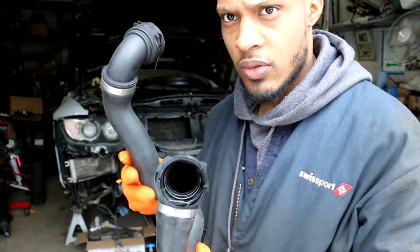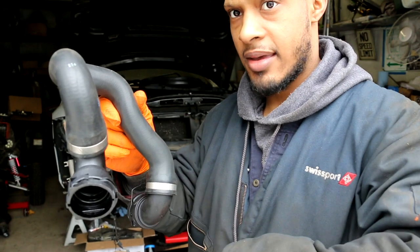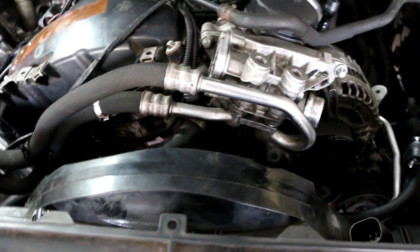I was having trouble with the radiator fan because I had the coolant hose routed incorrectly. After looking at the cooling diagram online, the hose actually loops up and then back down — that was my mistake. Now the holes line up. That radiator hose had to wrap around in a specific way — it was tricky. One side is tight and the other side is not too bad.